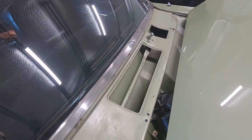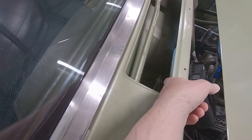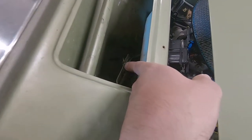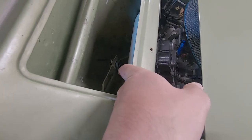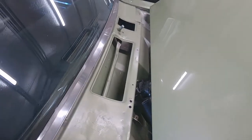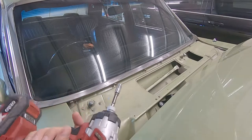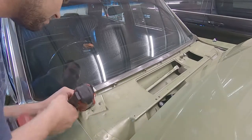To get these out it's only six sixteenth bolts — I lied, it's five-sixteenths — and we've got one bolt and clip holding the linkage to the wiper motor in here, so let's get that off now. This is already attached to the drill so I'm just going to do it the drill way.